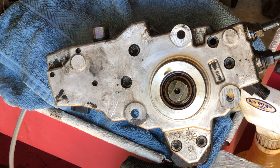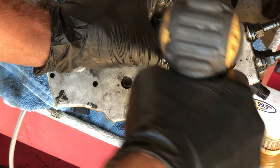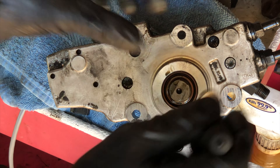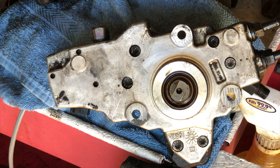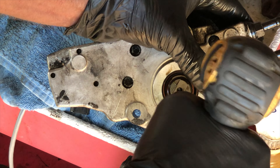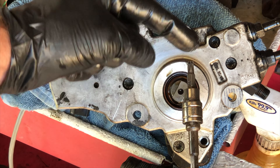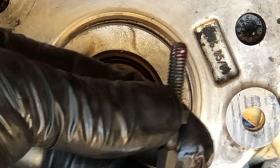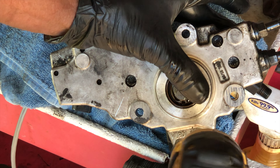Keep the cap on that and put that bolt right back. Repeat for all six — using a T30 bit for all of these screws, just a dot of thread lock on every one.